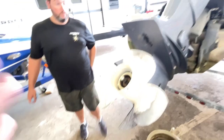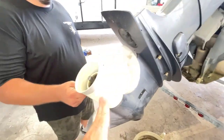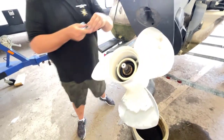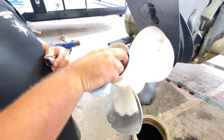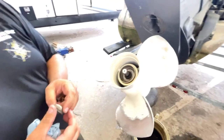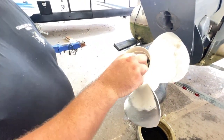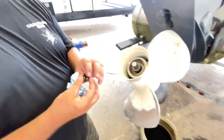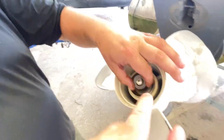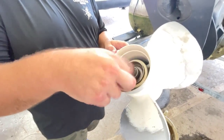All right. So now we've got the, what'd you call this again? The first one? Thrust washer. Thrust washer, prop. We grease the shaft. Check for any line. And now you're going to put your, what'd you call that? This is just a spacer. I'm going to call these spacers. I'm sure there's some kind of cool, real term for it, but I'm just going to call them spacers for the sake of not being wrong about them. And you see the direction that they're going. So this one's coming out. That one is the flat end because you're going to put the castle washer or castle bolt there.